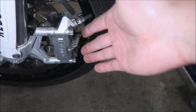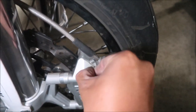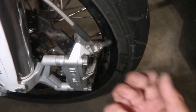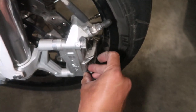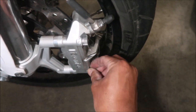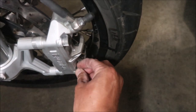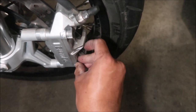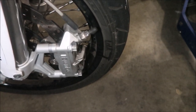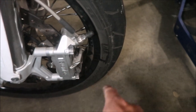Here's the area we're working with. We've got these lovely Brembo radial calipers, and as you can see I've got RTV on there right now. This will definitely keep your bolts from backing out, but it's a mess — you're gonna have to goop it up every time. They'll be checking this at tech inspection. There's a reason they do that: somebody's caliper has fallen off on the racetrack and that could be deadly.